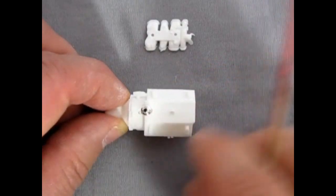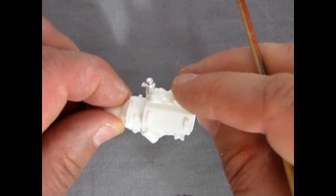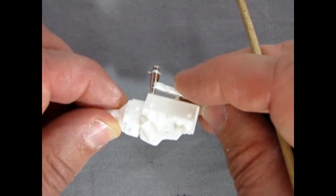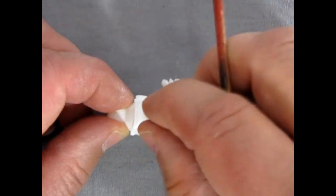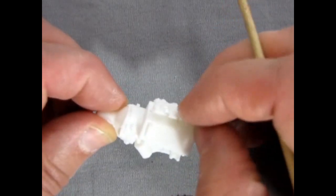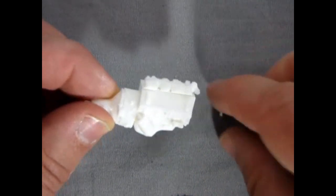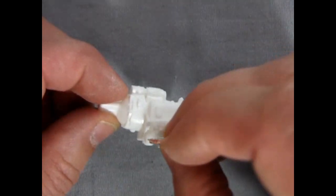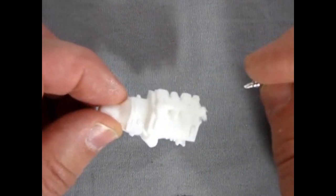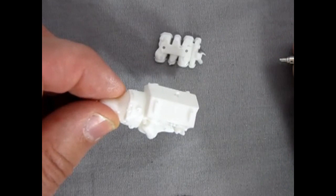But when it comes to our stock manifold, it's a different story. It's like the magneto prevents the intake manifold from lining up with that little pin. So the magneto has to come off, and then this will drop in nicely, just like that. However, now you're left with the problem that the magneto's never going to fit in there. So you have to come up with a different alternative to where the magneto goes, and I'll show you that at the end of the video.